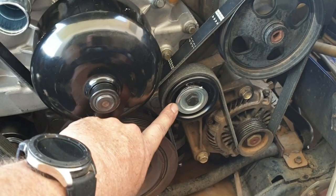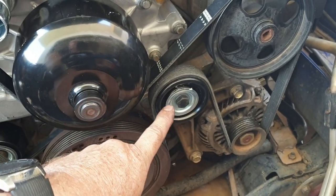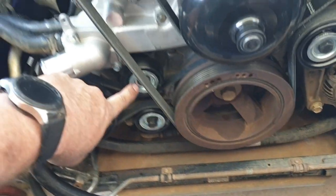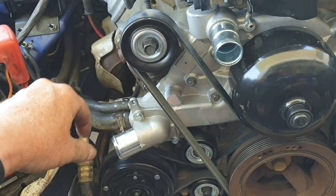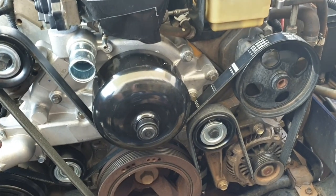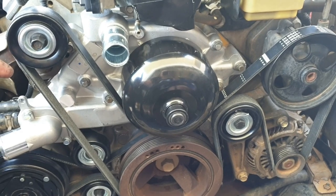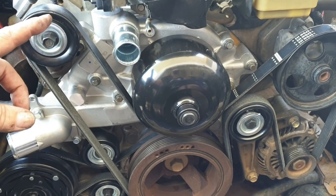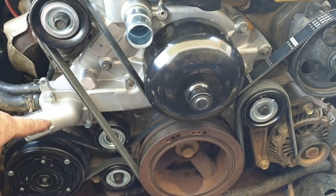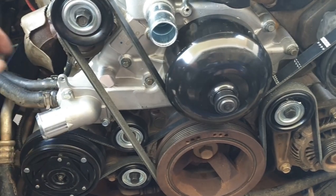All the idler bearings, because of the proximity with the rain, etc., coming through the radiator straight in here, this one, and this one, all cop a lot of weather due to the proximity at the front. So always change them. It's not particularly dear. In fact, there's a couple of eBay sellers that are selling kits with the water pump, idlers and belts all together, and thermostat and housing. And then of course I do the radiator hoses.